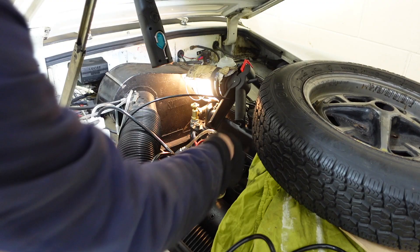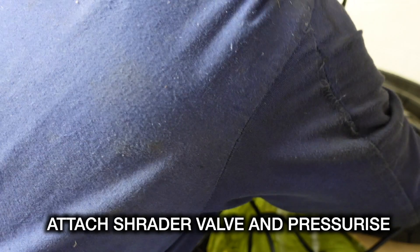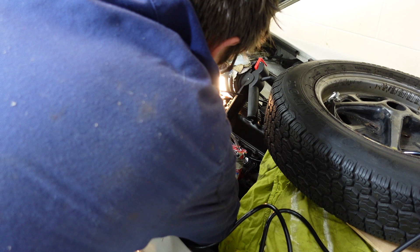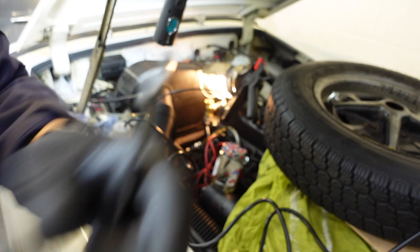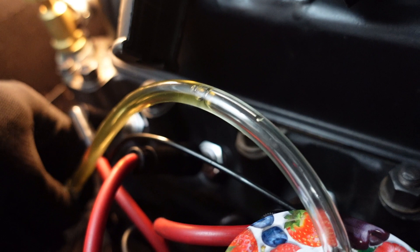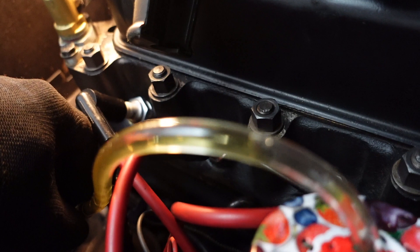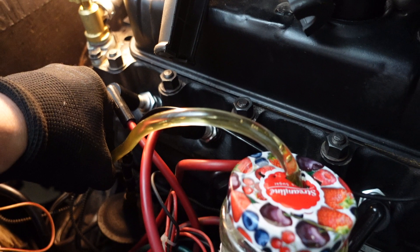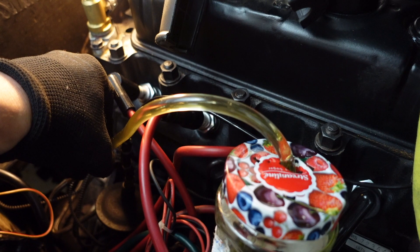Okay, let's do this. The system is pressurized — next step is to unlock the bleed nipple. I'm just going to stop it a sec so you can see — can you see there are air bubbles in this fluid? I unlock it a bit more — there come the air bubbles. Do you see? This is what we want out of the system. We don't want any air bubbles in the clutch system — we're going to bleed this clutch and get all the air out.